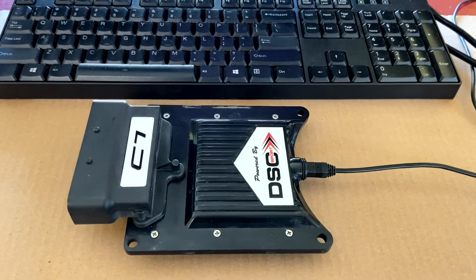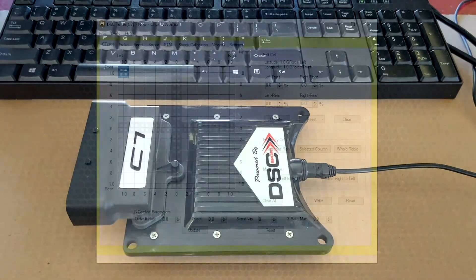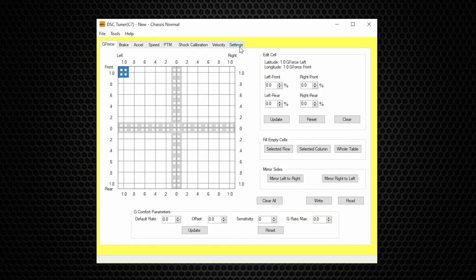We're going to do this demo using the software now, but again the controller must be connected to the car and the ignition must be turned on in order to zero the ride height sensors. First thing we're going to do is Tools > Reset Board to make sure we have communication. It is very simple to zero the ride height sensors. If you have your car with the ride height lowered, or for cars that have axle lift and need to zero it, go to Settings and go right to the Zero Travel button.